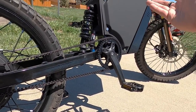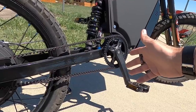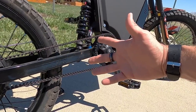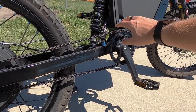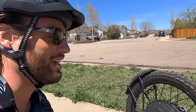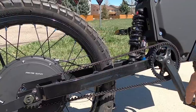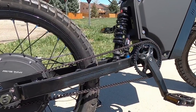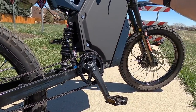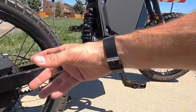I've been giving the drivetrain choice a lot of thought. For a bike this big and heavy, you're not going to be pedaling it very much. I thought: why put such an expensive premium belt drivetrain on here? But given the weight of the bike, if you had a derailleur setup with a standard bicycle chain you'd probably break it — this thing is so heavy it's just not going to be a good fit. The carbon belt is stronger and more durable, so I get it — it does add some price though.